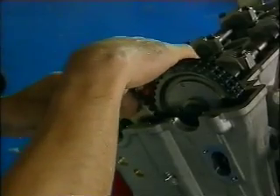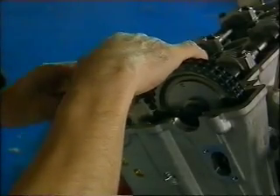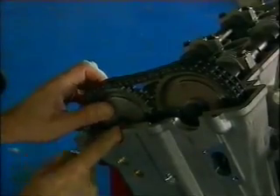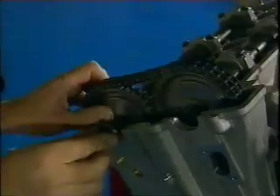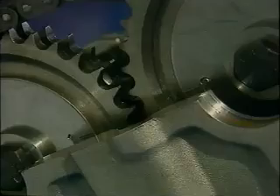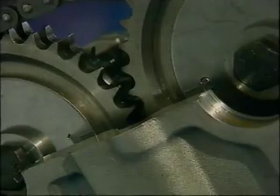The procedure for installing the camshaft sprockets in the right-hand head is precisely similar. The point to appreciate being that installation of the final sprocket itself will be tricky. Patience is needed to get it absolutely right, because this is the point where it's possible to assemble the sprocket just one link out of alignment on the chain. But providing the timing marks on all four sprockets and on the crankshaft damper are correctly aligned, all should be well.